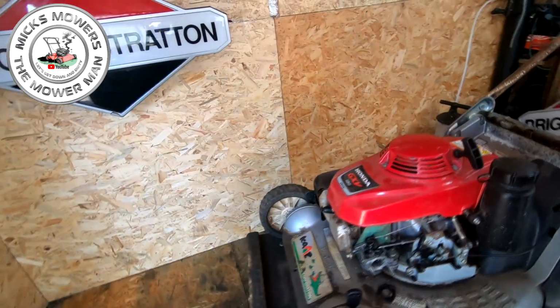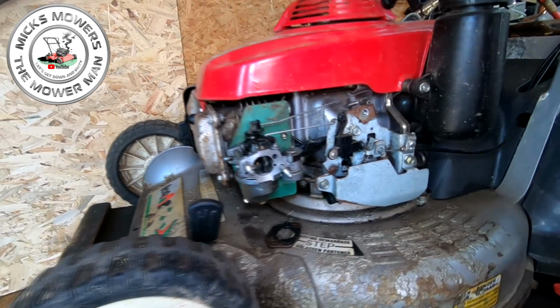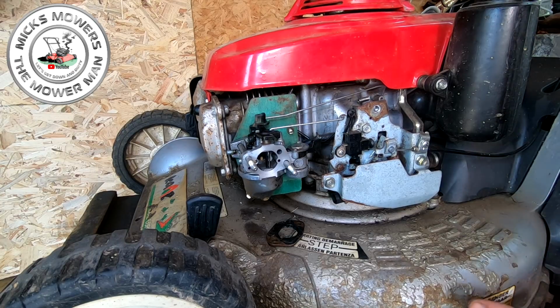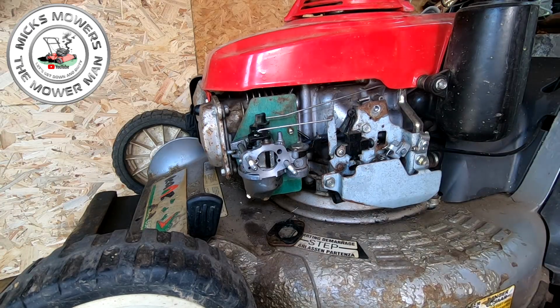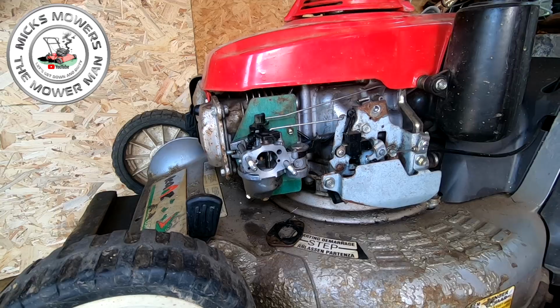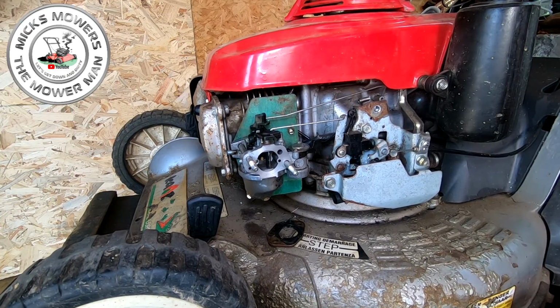So now if I put you back onto your perch, let's put you back on here and bring you in a smidge. So now I'm on idle, full throttle is there, and then choke is there, and now the machine fully chokes. So that's good, we like that. So choke, off choke, full throttle, idle, and stop. It should do everything I need it to do. I think that is stopping, yeah.